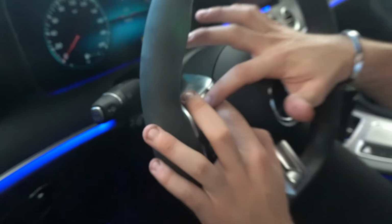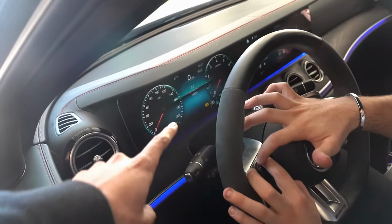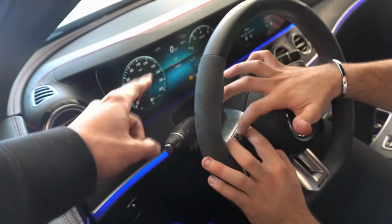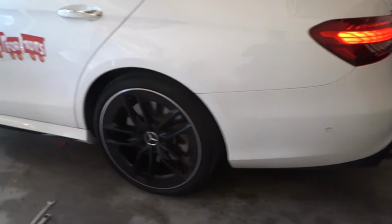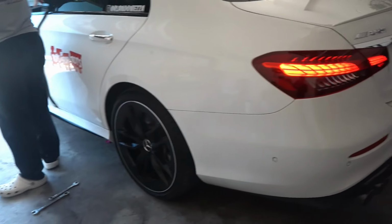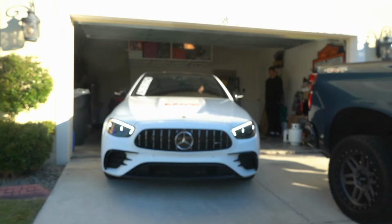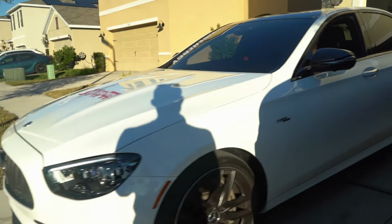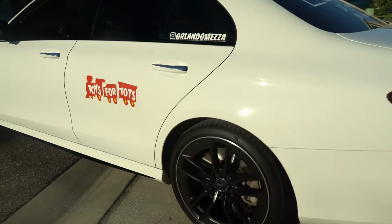This is the worst part. It took us like 20 minutes just to figure out how to put it in service mode. So to get the car in service mode, you gotta be in the trip mode, hold the home button, and then the OK button, and then it should pop up. It's done. Now this thing is done. AJ the mechanic, Air Force. No squeak. Test run.